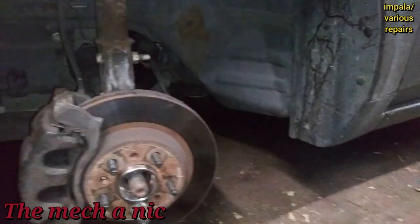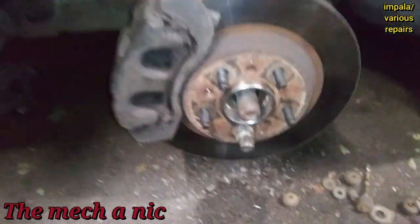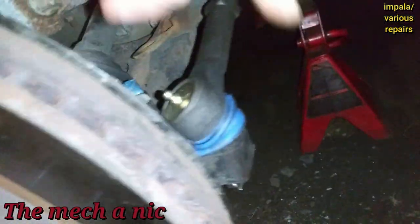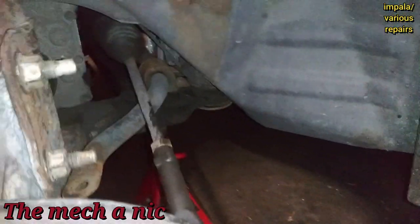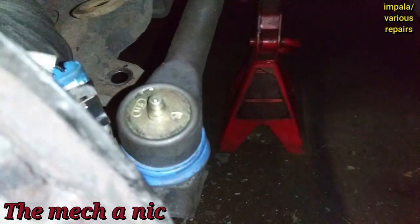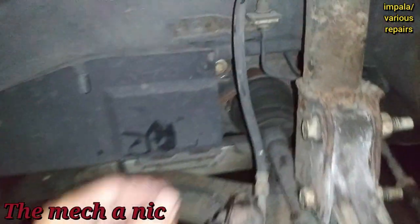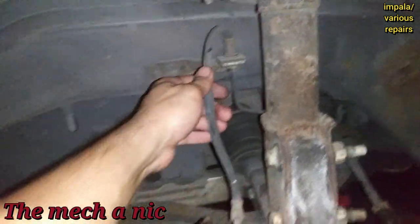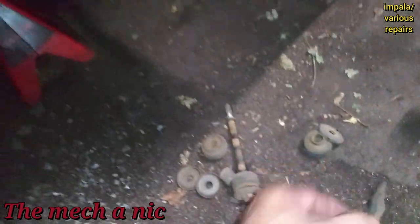Back with this Impala — it's about a week or two later and the parts are in. I put the wheel bearing on, the outer tie rod is finished, and I fixed the brake hose that was curled up in the wrong way. Just finished pulling off the stabilizer link.